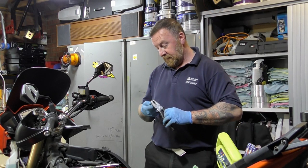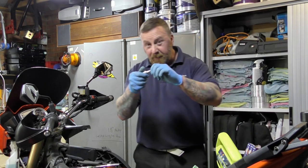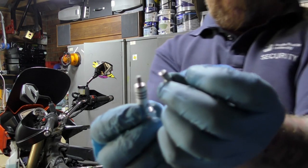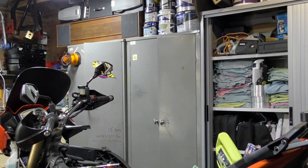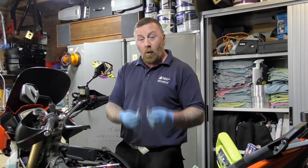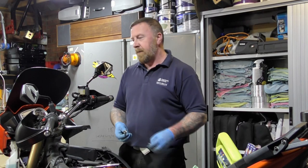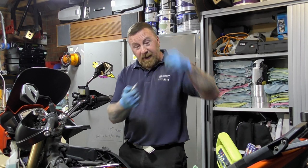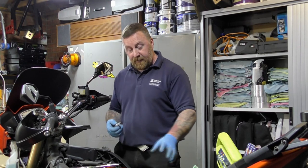Right. This has to come off. Done that before. Double check the plug. This one had the little tiny electrode funny bit on the top. It don't do it. So always check the plug you come out with. Always check the plug you took out and make sure that it is on. So once you've got the plug out, always check the top bit. Because if you put it in and it's not on there, it will run all funny and lumpy. So I'm just going to replicate this now three times, put it all back in, put the box back in,